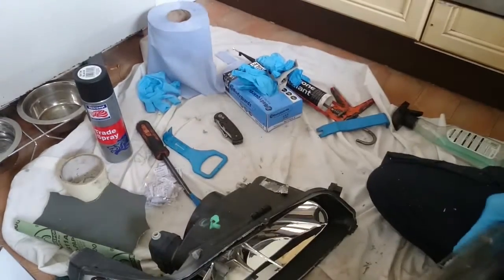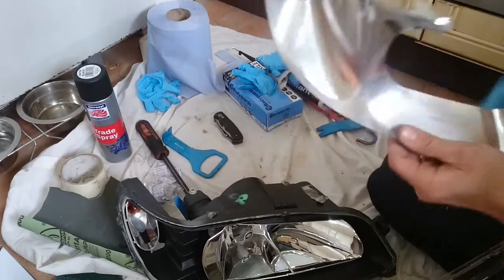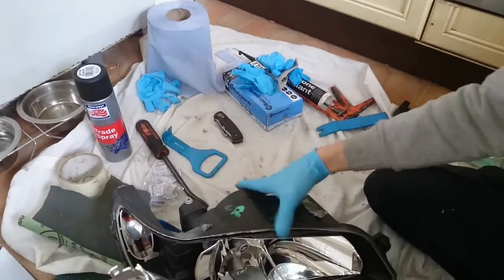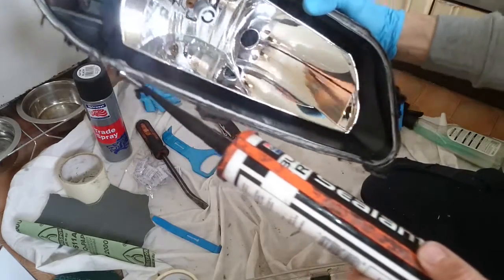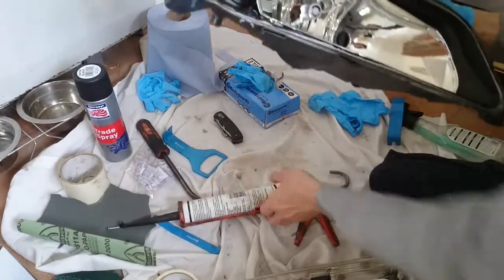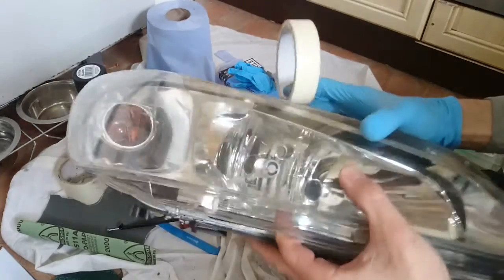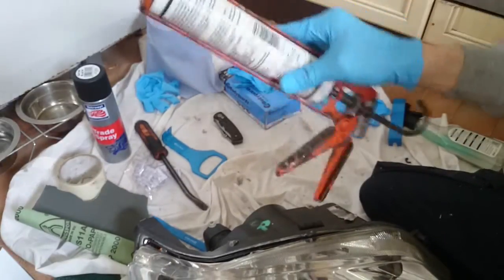Once you've painted up your lens - which obviously this isn't painted yet, it's just ready for painting - you fit your mask in. There are some little retaining clips that go in there and then it fits on. Get your silicone and put copious amounts around - after removing as much silicone as you can, you will be forgiven for leaving some in because it's a pig to get out. Copious amounts of silicone all the way around, then put it all back together again, push it together, use a little bit of masking tape to strap it all together, and give it three or four hours of drying.